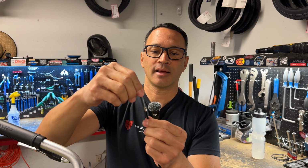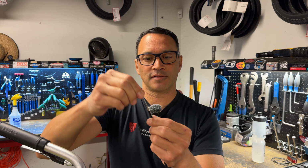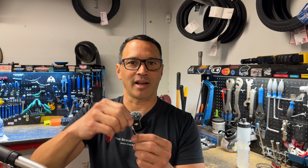I'm not going to go through all that, especially since the bike is new. Right. And then you start working the cable like that with a little bit of lubrication in there. 9 out of 10 times that does the job. If your cables are so corroded, so rusted out, that's the point now. Take it to the bike shop, have them replace the cables and the housings completely. But if it's just a little bit of dirt, just a little bit of dust, this works great every time.